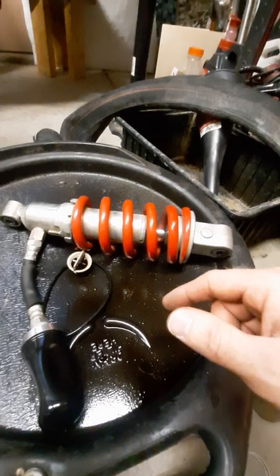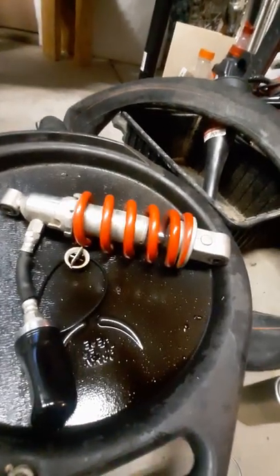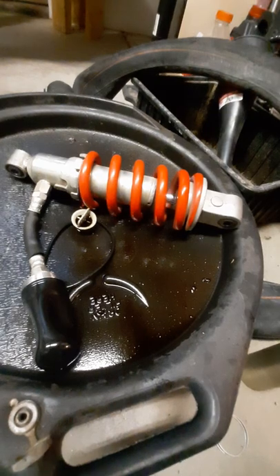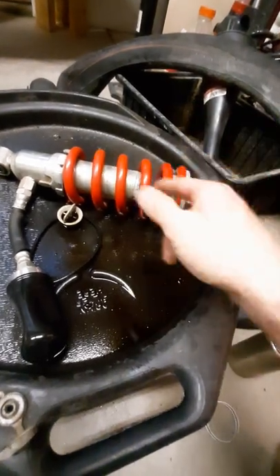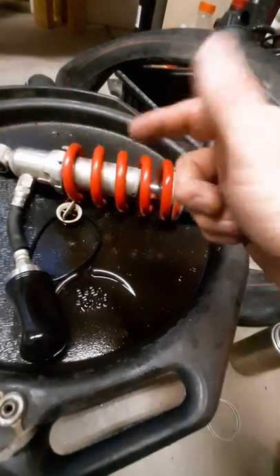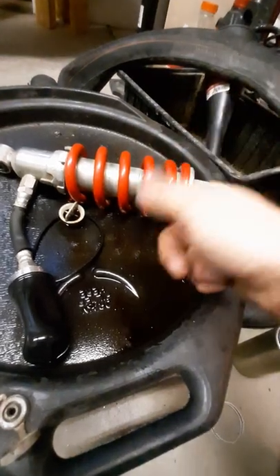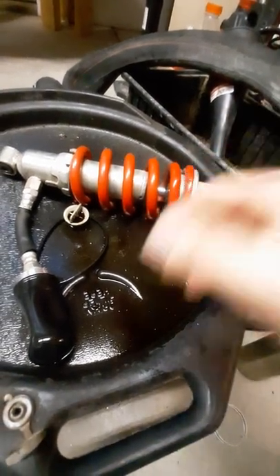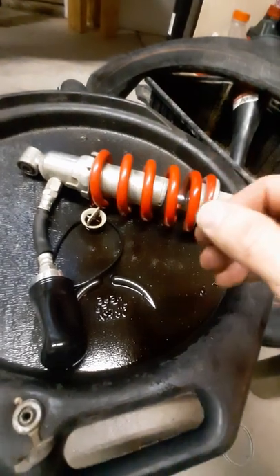Sometimes the o-ring gets snagged in the snap ring groove and it's a bit of a fight to pop it loose, but once the pressure's out, cap comes off, depress the seal head, circlip comes out, all the guts come out - that exposes your valving, seal head, all the internals. Once you do that you can dump the fluid. It should be pretty clean - no real source of debris other than a little bit of wear. There's usually a piston band that I'm sure is fine. If you want to clean stuff up once you get the seal head off the damper rod, there's a bolt on top that holds the piston. Underneath that the seal head floats on the chrome part. Grind the peen off the nut, take it off, remove the piston and valving, take the seal head off, clean everything up.